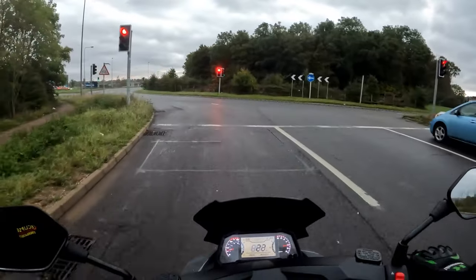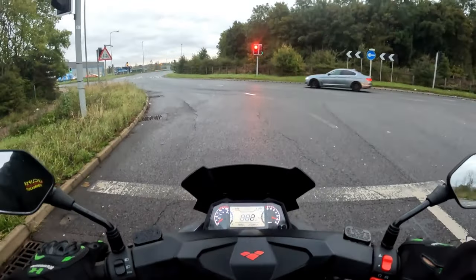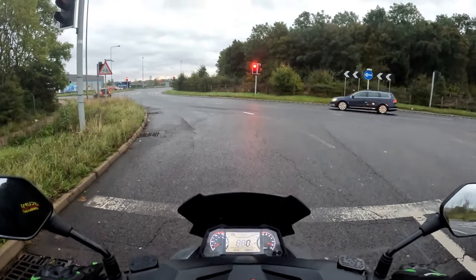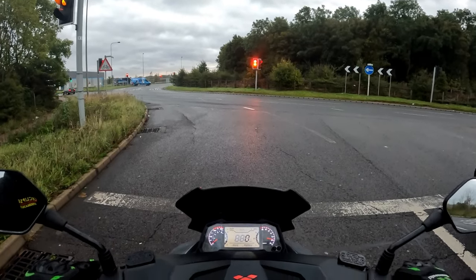Coming in on the front brake — just look at that stopping power. And it's got combined braking. So when you pull on the left brake, you will get 70% rear and about 30% front on it. So 2 to 1 on the dual braking.